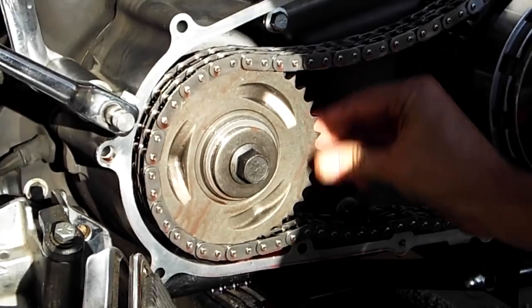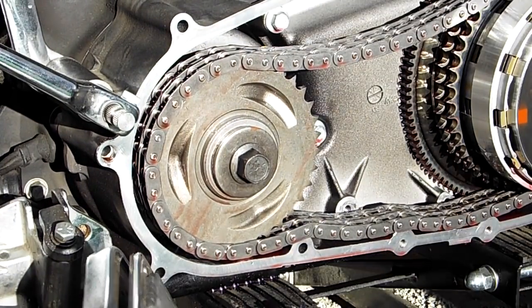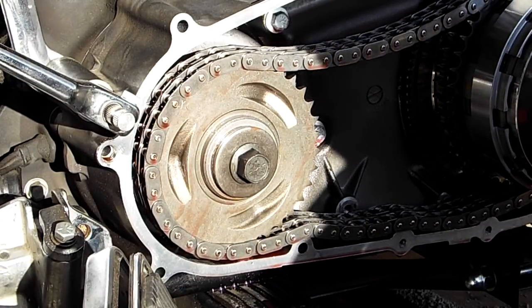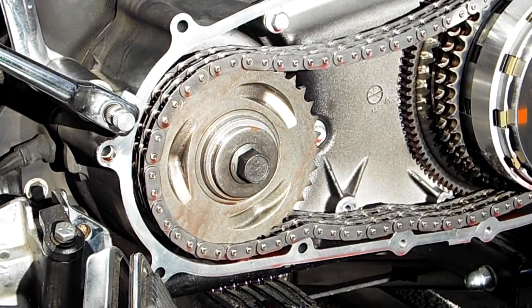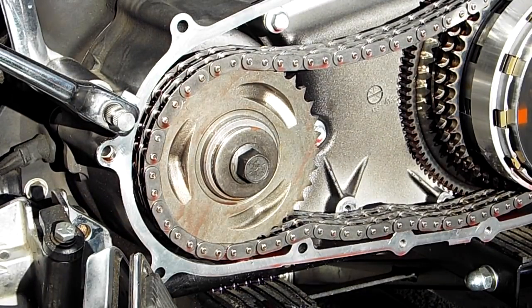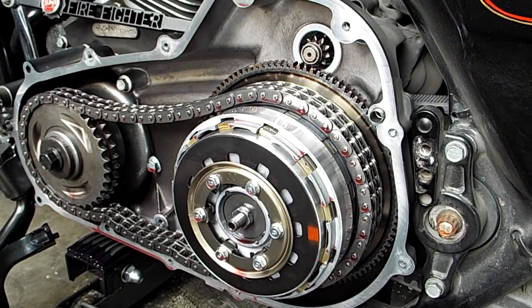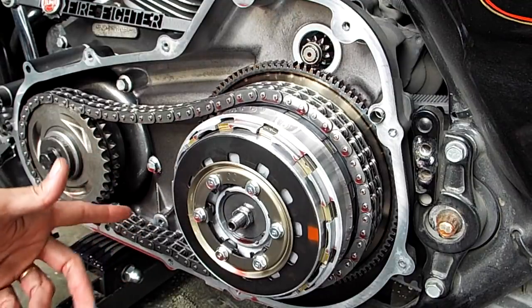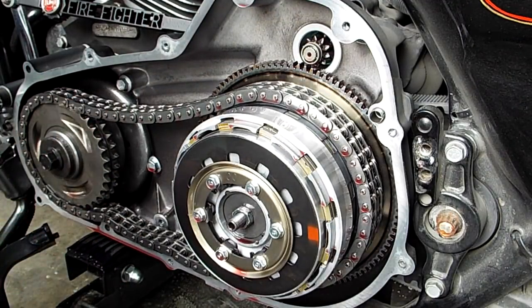And already I've got a tight sprocket pushing against that spring pack. So what I want to see is how well this will tighten up now against that spring pack to determine, is it too much? Is that too much pressure against the spring pack? That's what I want to find out. Okay, it is back torqued to 150 foot-pounds. Ready to put the primary chain tensioner back in. I'm using a Hayden unit and put the cover back on and all that fun stuff.